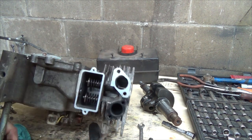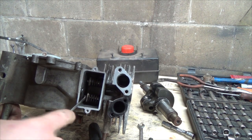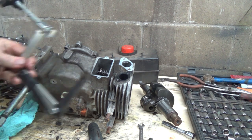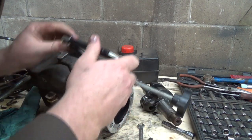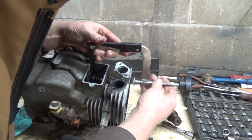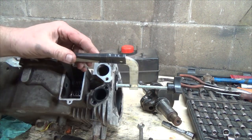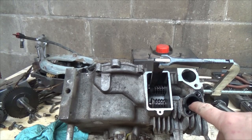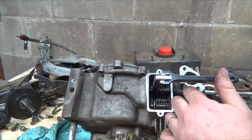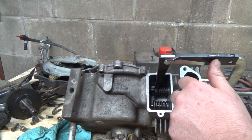So inside of here, it's a nightmare to get these valves out. I mean, you can do it with a screwdriver if you could get these in the right spot and then pull out that little keeper, but getting it back in is a complete nightmare. I've done it before, and that's why technically we should be able to put this on here, and this pushes down on the valve, so the valve won't move on you. Okay. Sure, I got you in a good spot here. And I think that's all good in there. So we crank this down. She starts pulling the valve, or the spring.